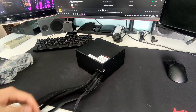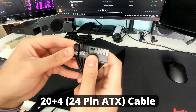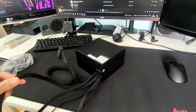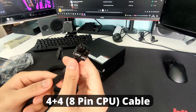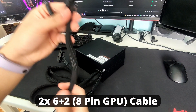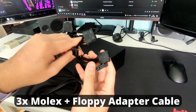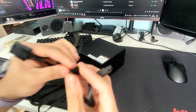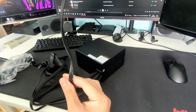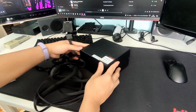Let's check out all the cables we have. First, we have the 24-pin cable that is detachable — you can use 20 or 24 pin. The 4+4 8-pin cable for the CPU. The 6+2 8-pin cable for the graphics card, and you have two of them on the same cable. You also get a 3-Molex cable with a floppy adapter at the end. A cable with 3 SATA power, and another one. And that's all the cables.